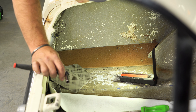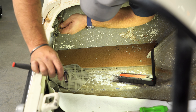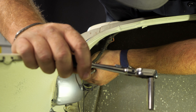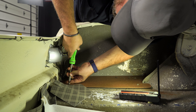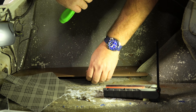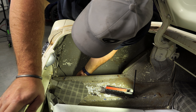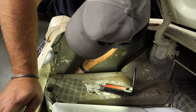That's ready to go on the car. The backup light harness connects to the taillight harness — this is the wire here. It comes up and it's plugged in right here, so simply unplug that. I'm going to remove this little nut. Now we'll have to remove our filler board. The wiring harness goes down to the side of the trunk filler board — there's a grommet here. Push the grommet through, then you can feed the wire down.